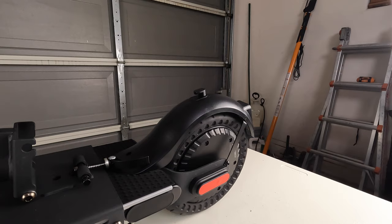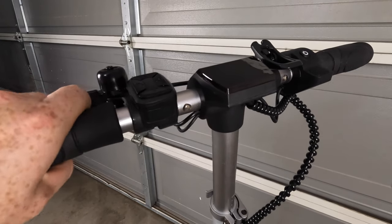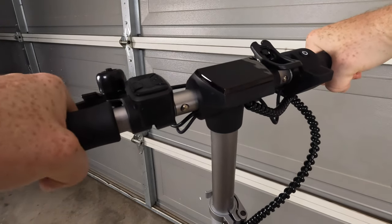In terms of weight and portability, the E68 Pro weighs in at 39.5 pounds without the seat and 44.2 pounds with the seat. Because the E68 Pro is a folding scooter, you can simply unlatch the stem, fold it down, and latch it into place at the rear fender — and if you're using the seat you can also lower and fold the seat as well. The handlebars are removable via two spring-loaded buttons you push in and then pull out, very similar to those Razor scooters from the early 2000s. Being able to remove those handlebars makes storage much easier. The one downside is there's about a millimeter of play in each direction on the handlebars when standing still, though you don't feel that play when actually riding.